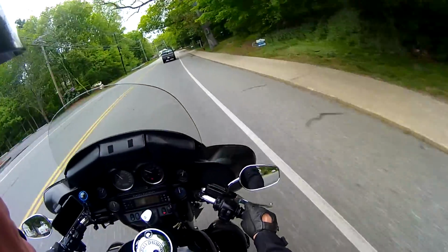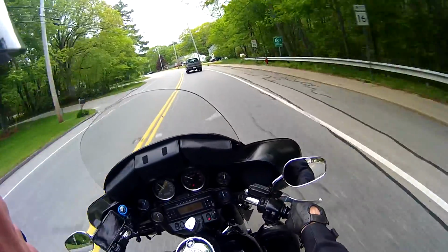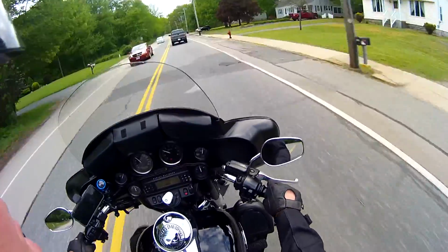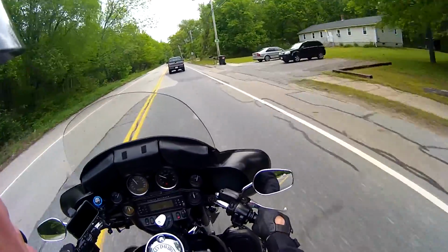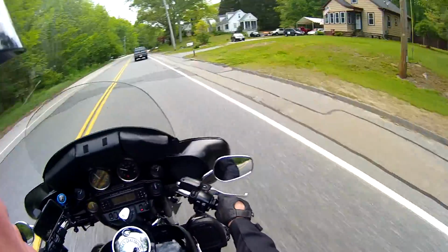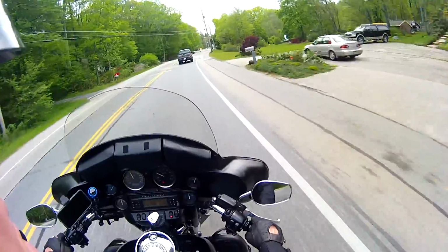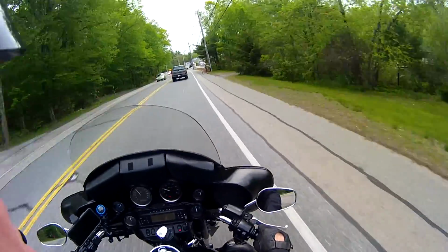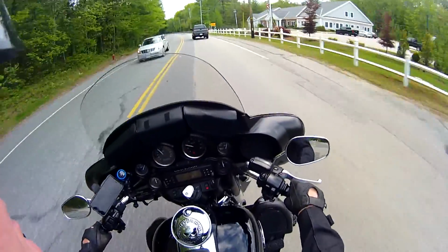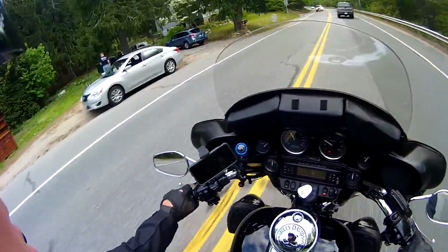So, in order for a Harley to meet today's emission standards, they leave the factory pretty restricted. They're running super lean, and the engine is just really restricted. It's not breathing well, either on the intake side or the exhaust side. So a lot of guys put slip-ons on just to get them to sound like something, because they want that classic Harley blub blub blub.